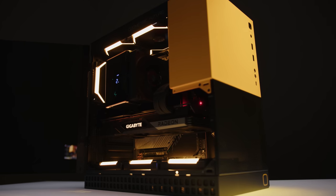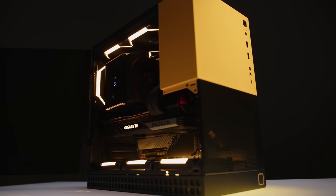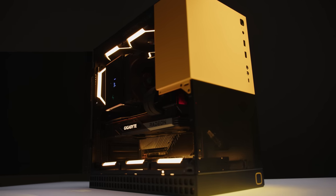And this is what we usually see with chimney layouts, with GPU temperatures being really good and CPU temperatures, if it's air cooled, being kind of average. Another thing to mention as well, the front panel is half open, like the side where the power supply isn't. And that does help draw air in. However, the airflow pattern for that is a little bit odd, as it's not really going to pull air in as much as you would think, because it draws in air from the bottom of the case and it kind of doesn't work like that with airflow, if that makes sense.